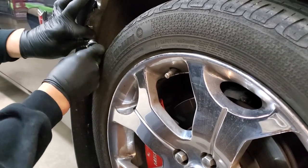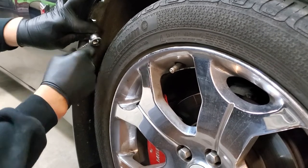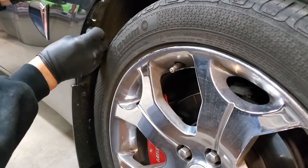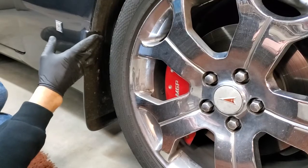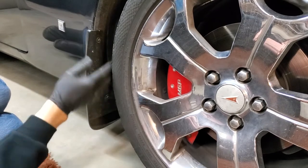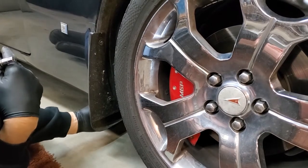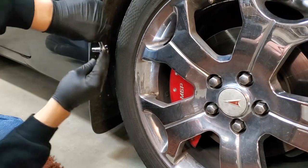We're going to remove this one next. It's as tight as it could be right now, so we'll start with the ratchet, then switch to doing it by hand — it's much easier that way. To remove the splash guard, if you don't have a splash guard it won't make any difference, but we've got one here. We're going to take this one out, this one out, and there's also one underneath here holding the bottom of the splash guard — you won't be able to see me do that. These are still seven millimeters.